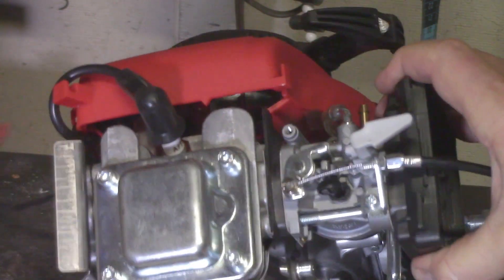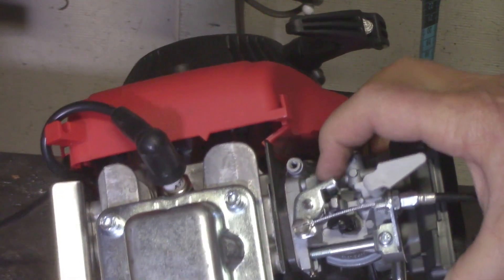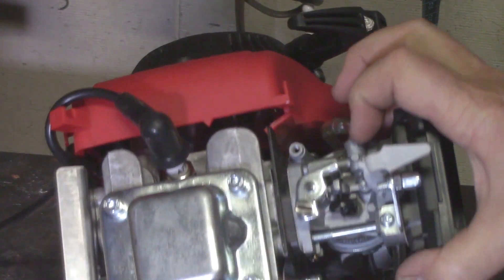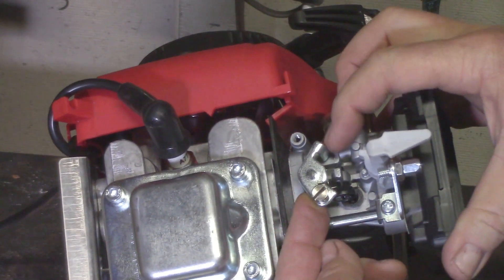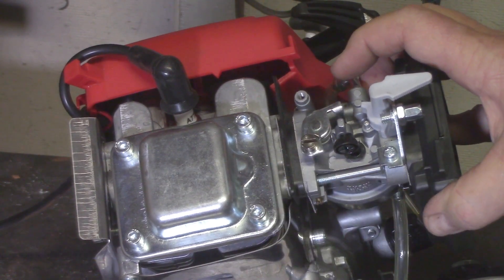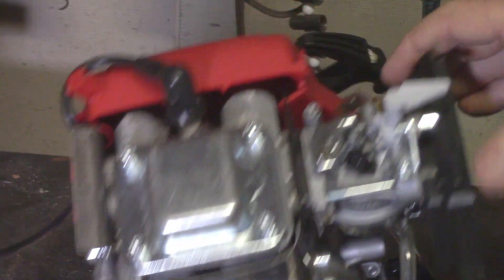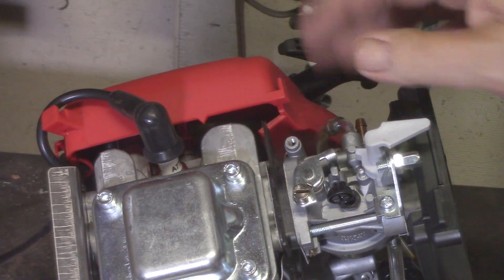You've got to be careful when you install your throttle cable the first time. When everything is released, this little tab bumps against the black nylon screw here, and that zeros it out — that's your idle adjustment. Screwing in on this little screw makes the linkage open further, and the more it opens, the faster the idle will be.